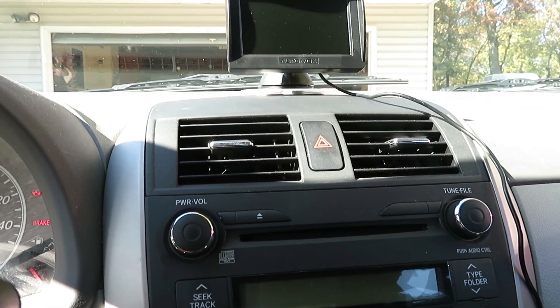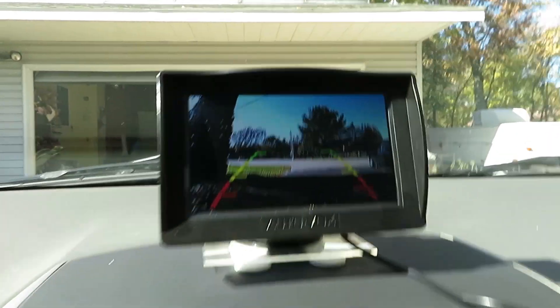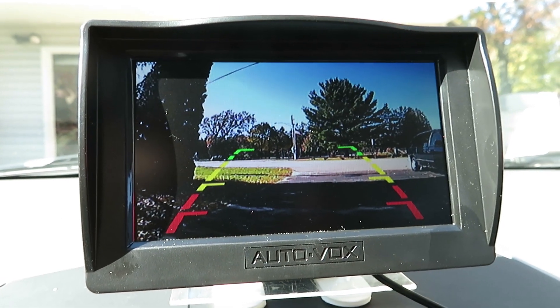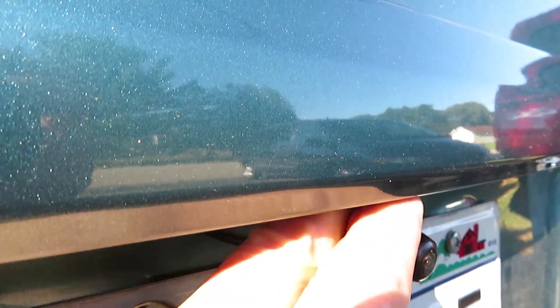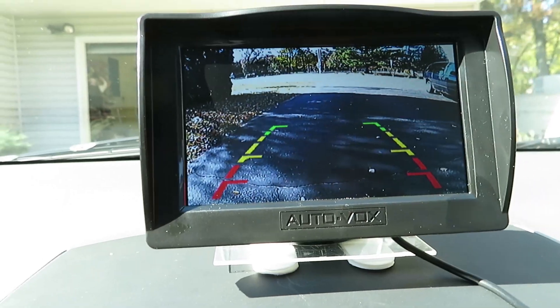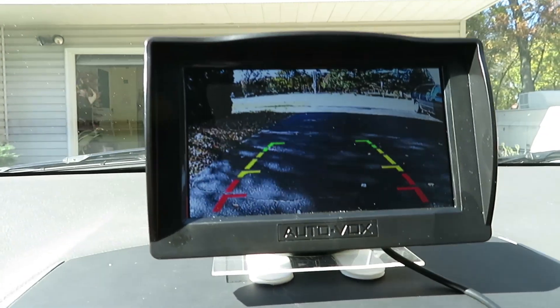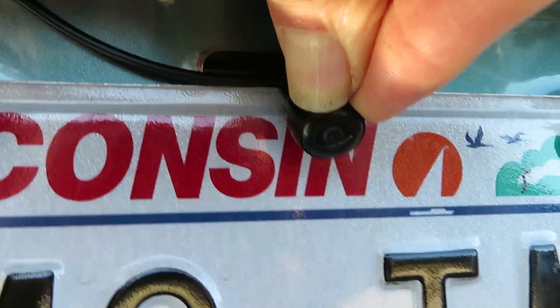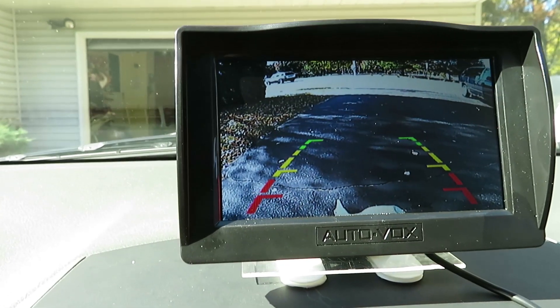Okay, we're going to check the aim of the camera now. Just turn the ignition on — don't start the car — go up on the parking brake and flip it into reverse. Without the car running, we can see our lines are much too high, so we've got to bring the camera down. It's just a metal bracket that it's on — very easy to bend. Now we're much flatter on our guidelines. I can just see the beginning of that plastic piece, so I'm going to move it down a little bit more. That's close to as far as it can go down, and there's our object to be aware of.